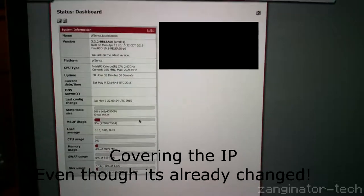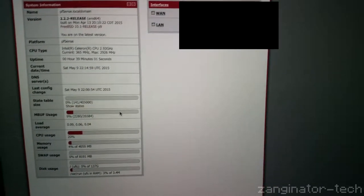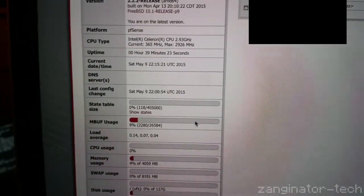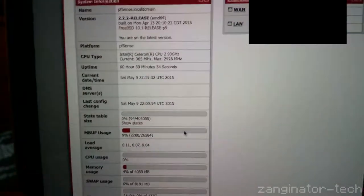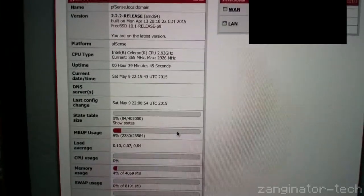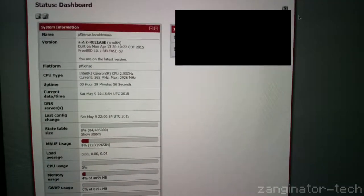Everything's working pretty well. Got the pfSense box logging in via PPPoE — perfectly fine. An interesting note is that when you're doing this, it doesn't list any DNS servers by default. Usually by default it gives you 127.0.0.1, which fires back to loopback on the firewall, then any that might be set over the WAN — in this case usually ISP-provided ones. But nope, nothing. Everything's running pretty damn stable now. Just need to get my OpenVPN set up so I can connect back in.